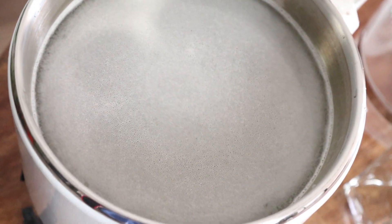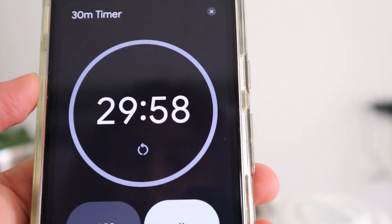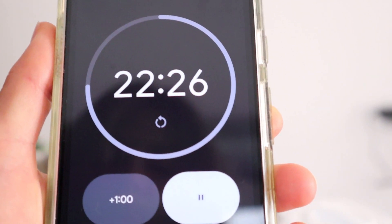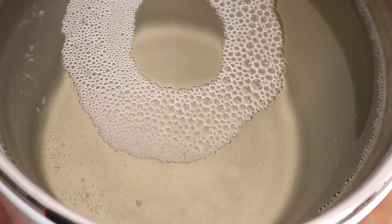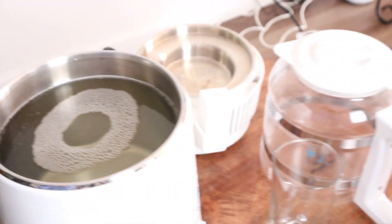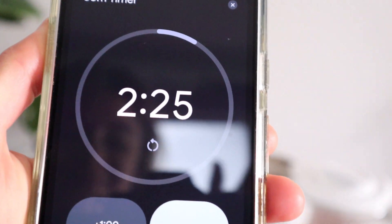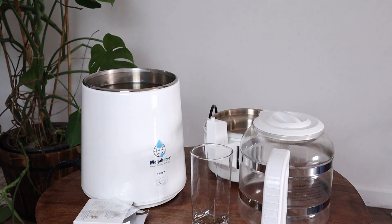Here is how the reaction progresses as the water in the tank heats up. I'm going to set a timer for 30 minutes so I don't forget that I have the distiller cleaning somewhere in the kitchen. In about eight minutes we can see that the water has changed color but it's clear, and we can still see the reaction is ongoing — so 30 minutes is a very valid time for this to clean. In half an hour we can revisit our chamber and discard this water.